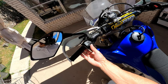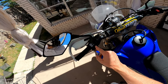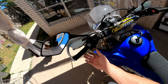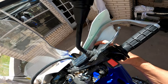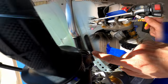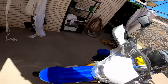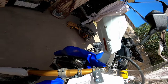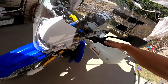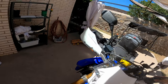Another issue I found when I bought the bike was that the turn signal was very sticky, so I opened it up and cleaned it out with contact cleaner and lubed it a little bit — it now works much better. The front turn signal was also not working. I found one of the wires feeding the signal was broken so I repaired that, though not all of the LED array works — about half is working now. It did pass inspection like that, but eventually I'll get more visible front turn signals.